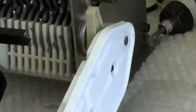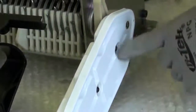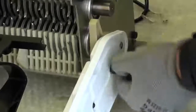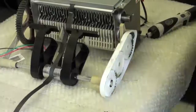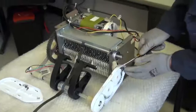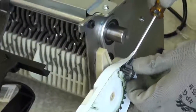After you remove your Allen key screw, get your screwdriver and remove the two screws here holding the gear cover on. Let's go ahead and remove the gear dust cover. Now that we have inside the gear cover, let's get our feed arm pinion gear out with a flat head screwdriver and just pry that up.